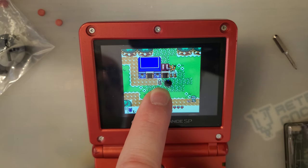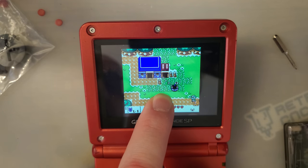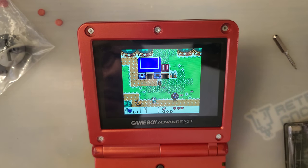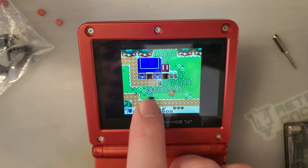First, we look at this guy's chain. The original Game Boy did not have a way to achieve transparent sprites. But due to the abysmal pixel response time of the original screens, devs found a workaround where they just toggle the sprite on and off real quick, and that gives you a slightly transparent result. Because the response rate of a lot of newer kits is so much better, that results in some quite visible flickering. But it looks like this is actually giving one of the best results someone could hope for. You see a little bit of flickering if you look for it, but it is largely transparent looking.